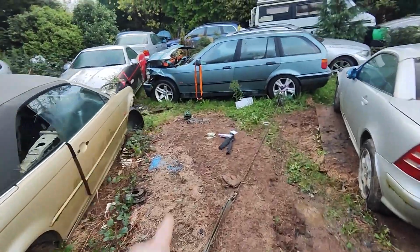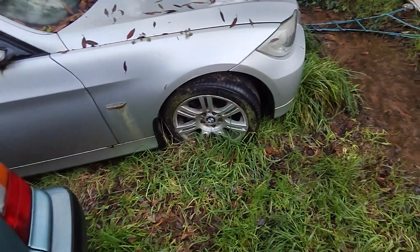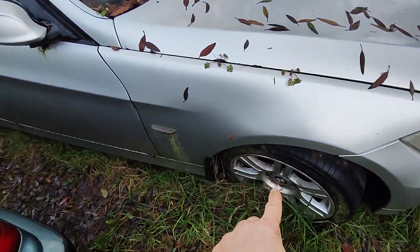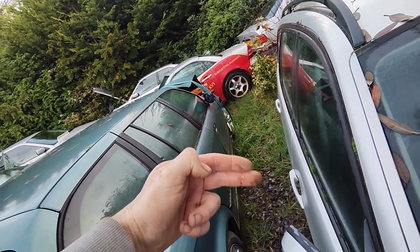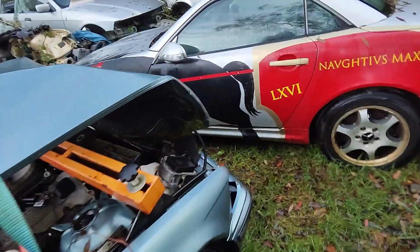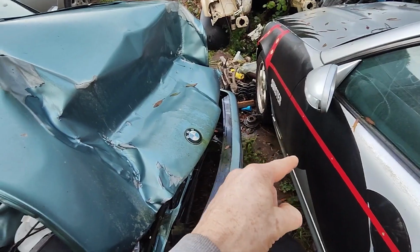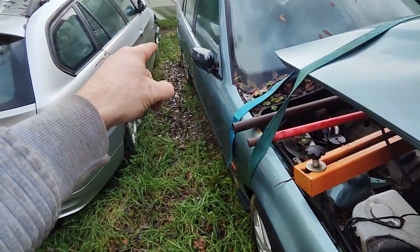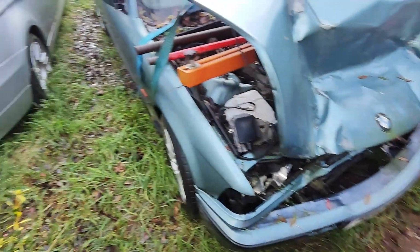And that chain hoist down there, and that strap, and that other little lift sling, I'm going to put from this wheel down to that wheel there, so that I can pull it this way, so that as it comes back this way and swings that front end in here, we're not going to hit this car. I can pull this back up that way and get the whole thing to swing, basically. So that's the next pull we've got for today.